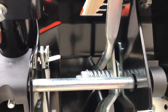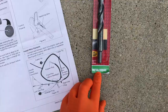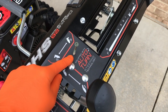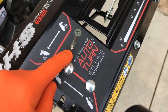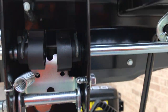We didn't have a half-inch bit, so I had to go to our local Ace Hardware and purchase a drill bit — heavy duty, make sure it goes through metal. Here's what I did: I grabbed a hammer and a screw, found the exact location to drill the hole, and tapped the screw into the actual panel to give it an indent. That will not allow the actual drill bit to roam.